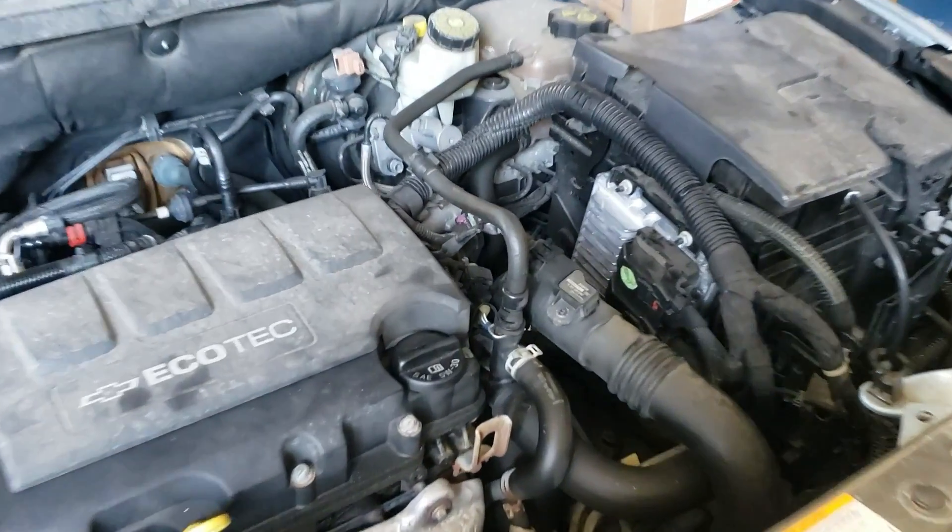The next job was a 2011 Chevy Cruze. The customer - actually the technician - had called me on the phone asking a few questions a week or so ago. He was saying that his NOID pulse was weak, and that's why he was leaning towards the computer. I told him to get a scope on it and check that. I've seen this a couple other times where you get a NOID light that doesn't really blink very well on this non-GDI standard injection turbo - the 1.4 turbo on a Cruze. He ended up calling a computer, put a computer in it, and we programmed the computer. Of course, we have a crank no-start situation.